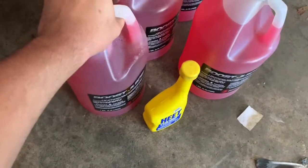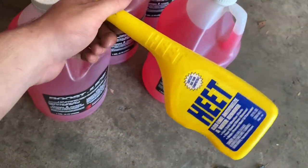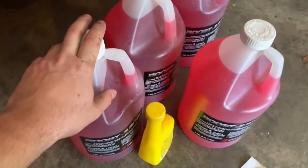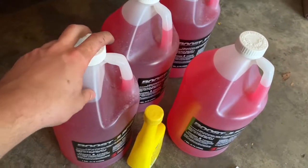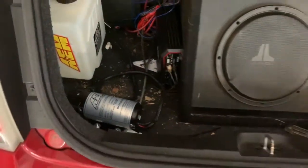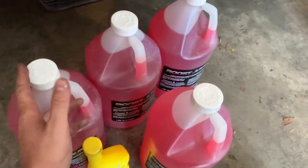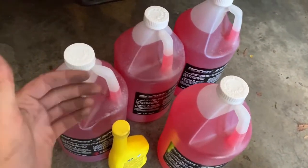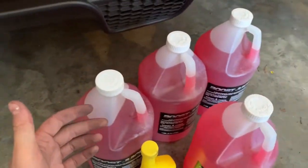So there's the stuff to mix it with — pretty straightforward. Some people don't care to know how to mix this stuff and they buy it pre-made. But just in case you're in a pinch, you can get this stuff. And if it happens to be wintertime, you can go ahead and pick up some windshield wiper fluid. Some people will have the methanol kit actually linked to the windshield wiper reservoir, which is cool. You can use your windshield wiper reservoir as an option, and you can do that with this AEM kit as well. My methanol is currently set up to spray around 8 psi or so, up to 25.